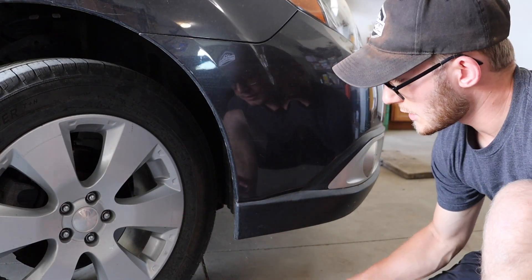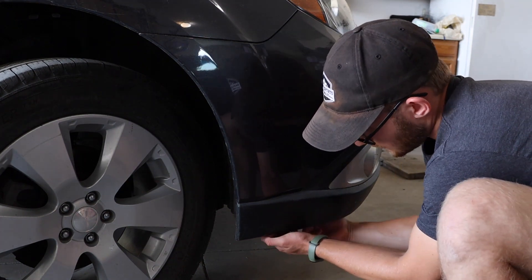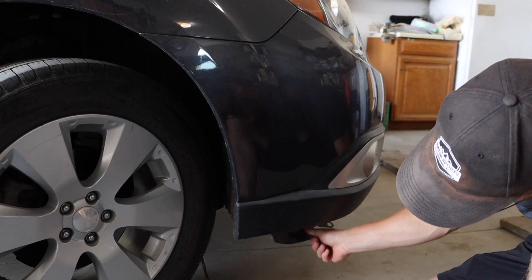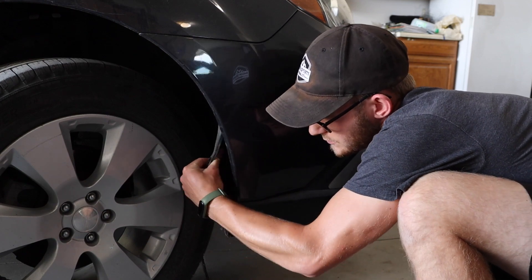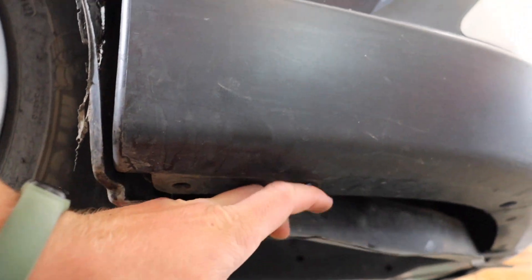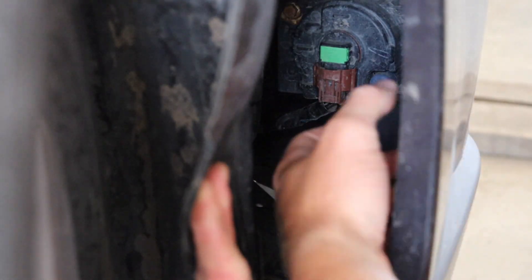I got the clips out and the wheel turned, so now I have space to get in here. There's a plastic lining at the bottom of my bumper and I'm going to pull it down to release it and free it from the lip. What I did was pull this plastic liner out from the lip of the plastic bumper, and now I have access — you can see the bulb inside there. On the underside I just pulled that down out of the lip as well.